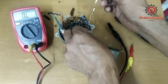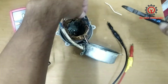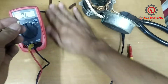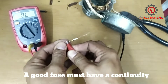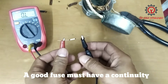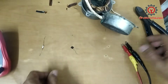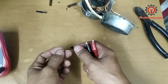I'm going to show you what this is — the fuse, guys. Here it is now, let's double check. Put one probe there and the other probe here — it's open. It's a 2-ampere thermal fuse.